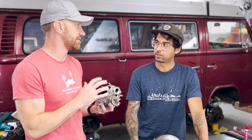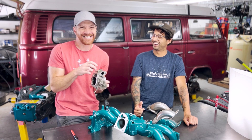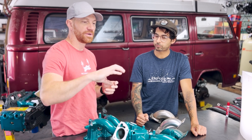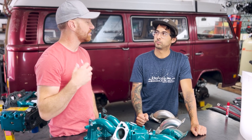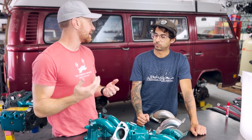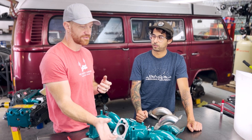It's a fitment issue, but that also causes us to need some modification to the throttle body itself. In terms of performance, we've not noticed any differences. Early on with our intake system, if we made it too short we got a slight howling — just an audible thing — but when we extended the intake pipe, that went away. You're not really sacrificing anything from reversing your throttle body.